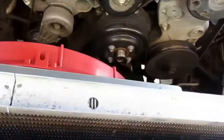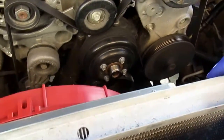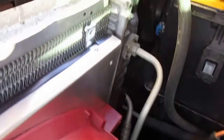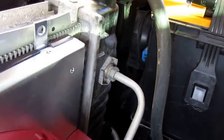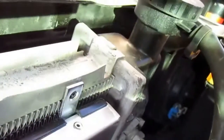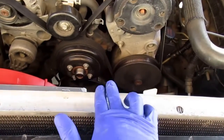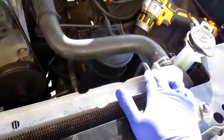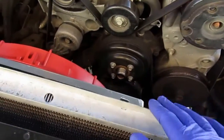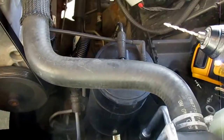It tells you to take out your radiator, but I think we can get by pushing it forward and hooking this on. I lined this up with the dots and measured a half inch on that side, a half inch in the middle portion as well — so one inch and a half inch there. It's a total of 34 inches across. Each fan is 16 inches, which gives you 32.